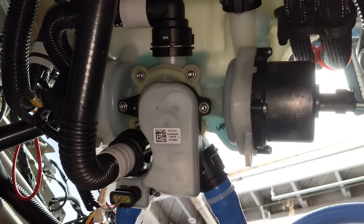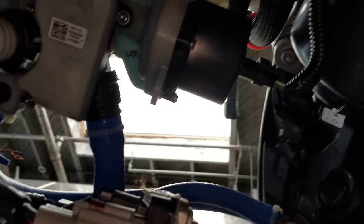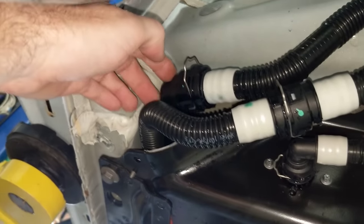At that point it could be a complete loop, or it could probably put in series with the powertrain loop. The powertrain loop comes down the other side. There are two separate pipes: one coming off the bottom of that four-way valve right there, and the other one comes up and goes out of that pump. So the bottom one must be the return and this is the output being driven by that pump. That output comes down here and goes into the top of the two pipes that travel down the passenger side rocker.